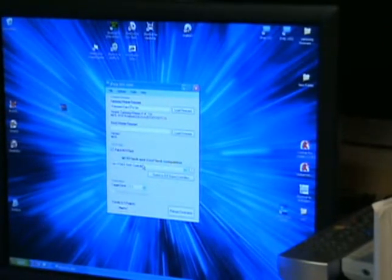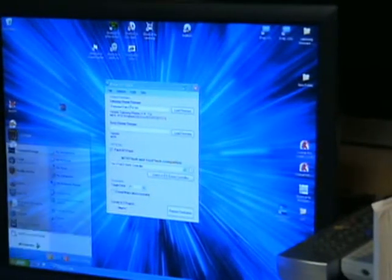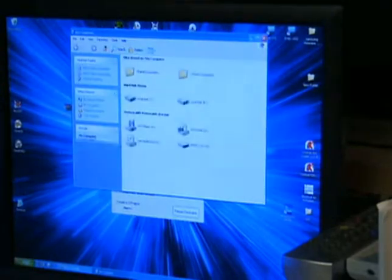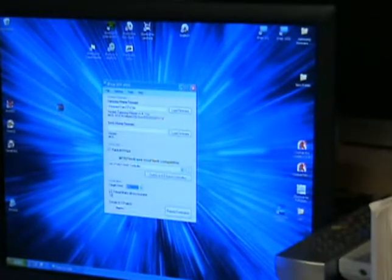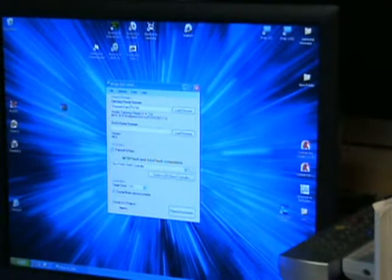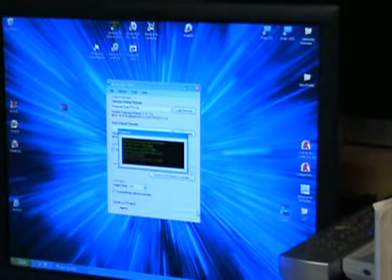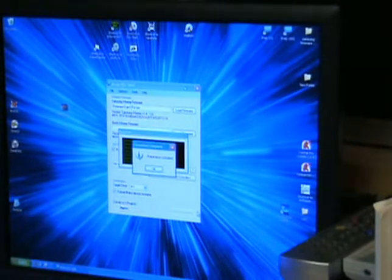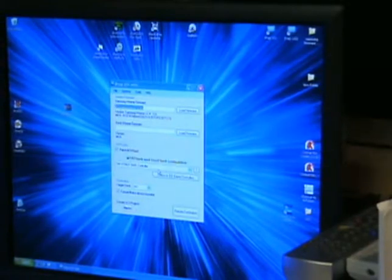Make sure your RAID controller is right and your target drive is right — ours is H. Put a check in 'Format,' 'Make Device Bootable,' and 'Prepare Destination.' This is building your flash drive that we're going to boot off of. Most people use a flash drive now, though you can also do this with a floppy. Click OK and wait for it to finish.